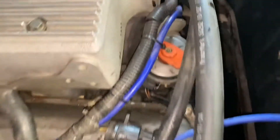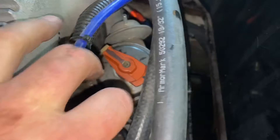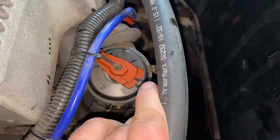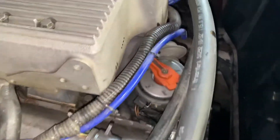Check for no burns and no cracks. Mark your dizzy so that when you put it back you know you haven't reversed the timing. Once that's done, you can move in deeper.